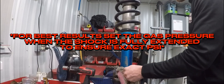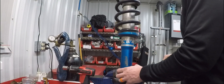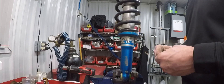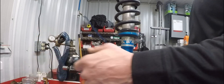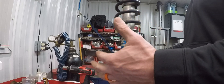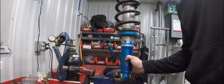These Schrader valves are holding up nicely and not leaking. The reason I check them going into the cold season is the same as tires — when does your tire pressure drop? When it's really cold. Same thing with shocks: you lose pressure in cold weather. Going into the cold season you want to make sure they're topped off and at the proper gas pressure.